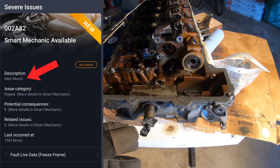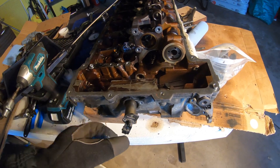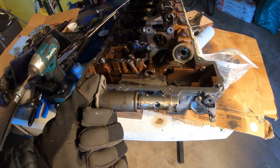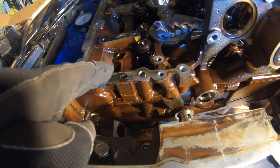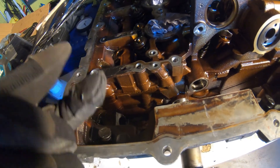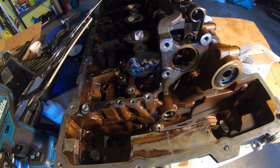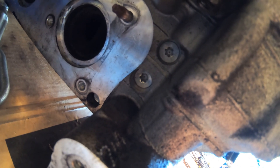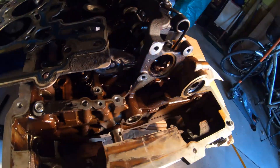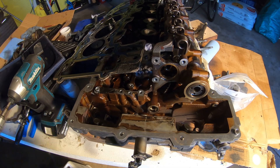We've had a bunch of codes over the years. Normally it doesn't deal with the cam gear and timing chain — luckily that's a bigger problem if it is the case. It normally revolves around the seals or the solenoid going bad. You could also have a really sludged up engine — as you can see, there's a lot of sludge here, almost like a paint. These sensitive components need to be maintained with regular oil changes. You can also check the little filters in the back — those two little holes are not bolts, just filters. Unscrew them to clean that area out, as it does get gunked up from time to time.